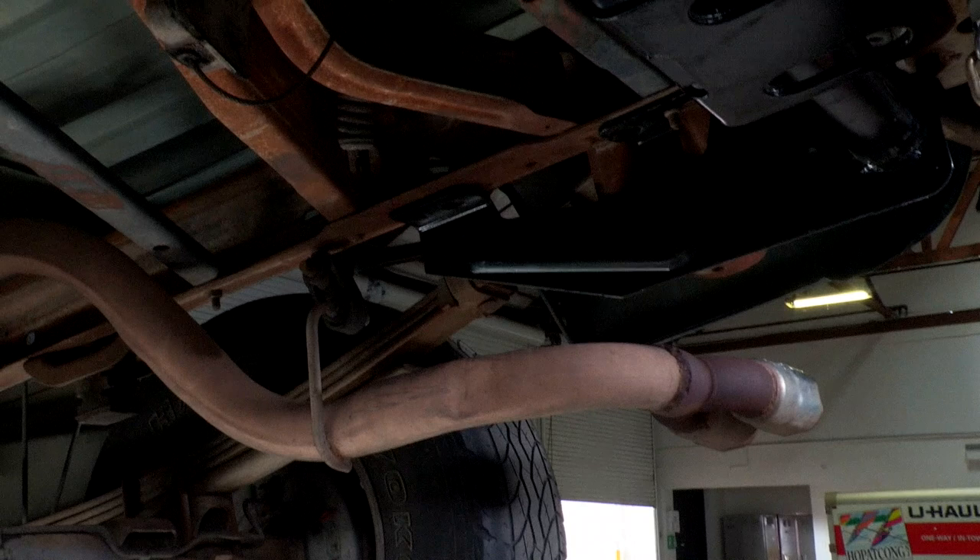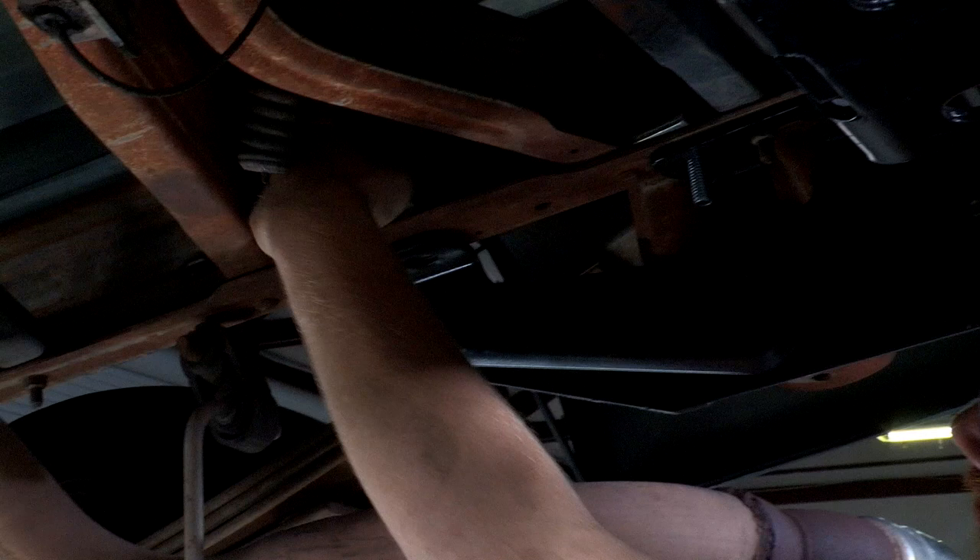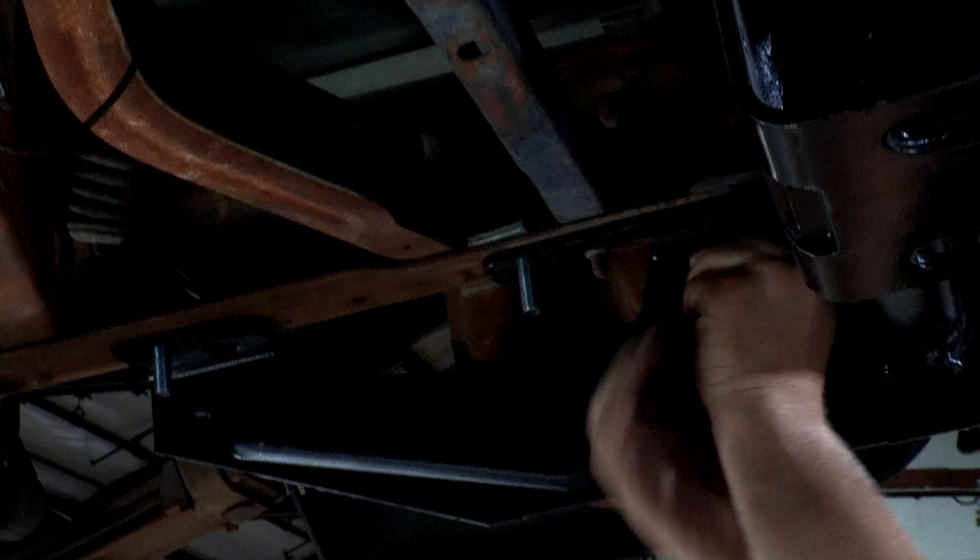Let's move to the passenger side. Over here on the passenger side, once again we're going to take our offset plate with hole and our carriage bolt — that's going to go up here in the center. Then our centered plate with carriage bolt goes in the forward-most attachment point, and then our bolt with conical washer into our existing weld nut.